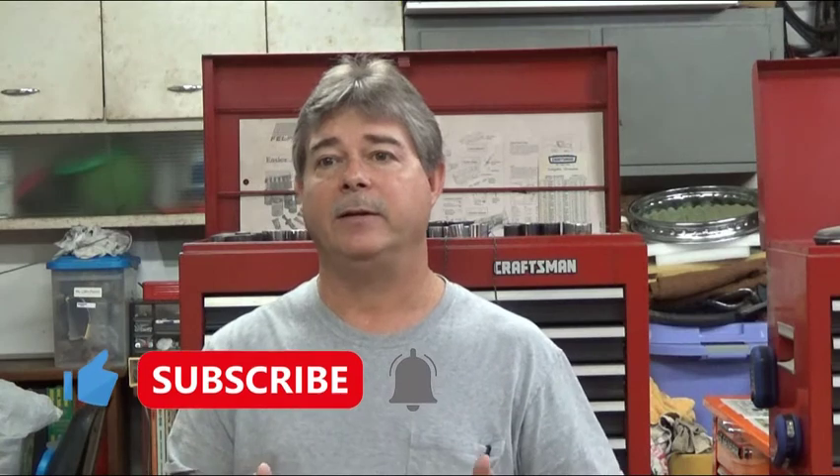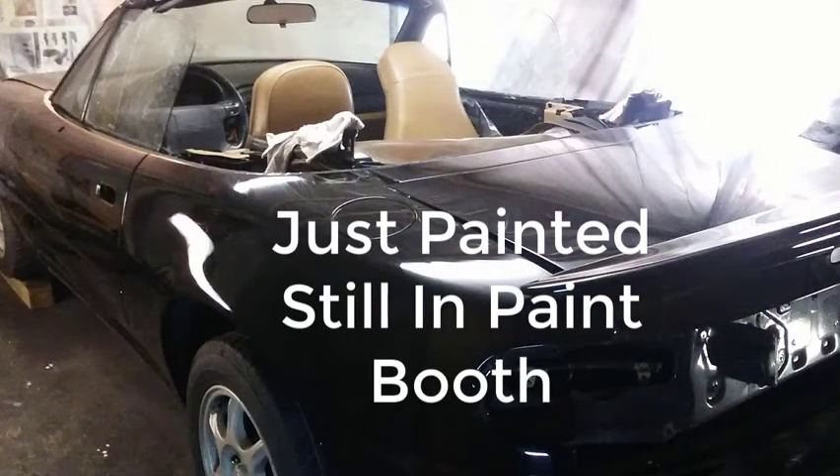Flowing air is the big trick of keeping trash and dust out of your paint. That's why you have updraft or downdraft booths — a lot of paint booths have a big grid that flows the air either upward or downward. I've painted for years out of a paint booth I made in a home garage that just rolled down plastic. The front had holes with central heat and air filters so the air coming in was filtered. I took out a glass panel in the garage door, put a fan in it going into a box, and made a filter system to keep from over-spraying onto the neighbor's property. The air flowed perfect, the paint would dry really quick, and I've quite often barely had any dirt in my paint.